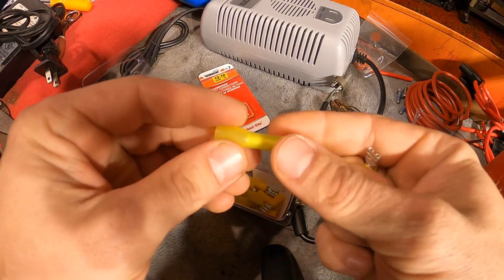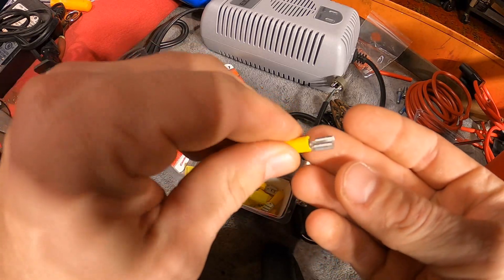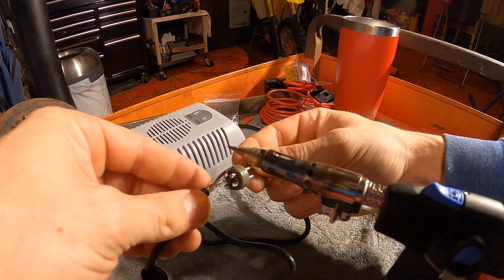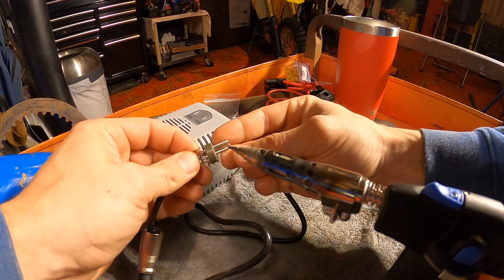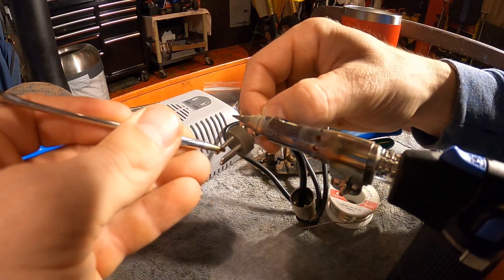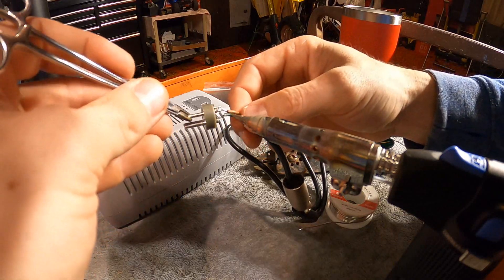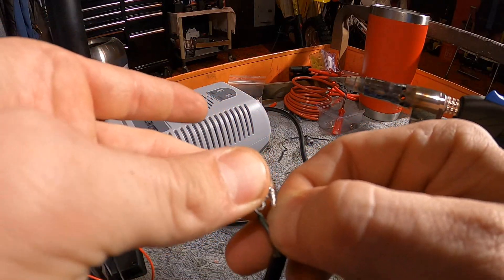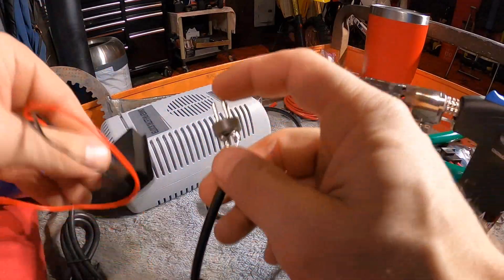I picked up two different connector styles — one is a crimp-and-heat-shrink inline connector, and the other is a female battery terminal connector. I got these at a local Advanced Auto. I got my iron on and literally just a quick bit of heat and that wire popped right off. Now I'm simply moving the wire over to pin two. I got the charger re-soldered — nothing pretty, but it's definitely holding solid. I'm going to button the charger back up and get it ready.